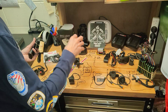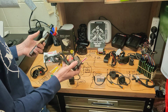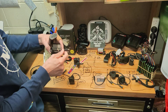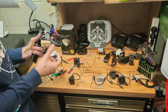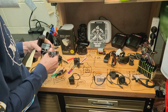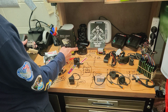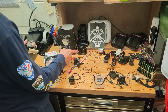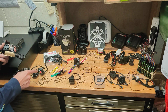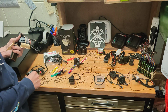The DC 7.2 volt version of the headlight fixtures that support these batteries interact with the low and high beam switch on a Y cable off this 7.2 volt DC connector. So that's how that switch interacts. So potentially with the Turbo Torch fixtures, we can take this out to a 3-pin instead of a 2, and have that 3-pin then drive the high beam switching off this switch here, which would be nice, right? Because one light then does low and high beam switched easily.